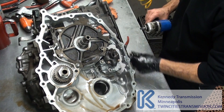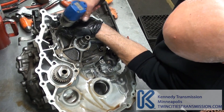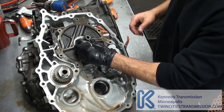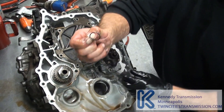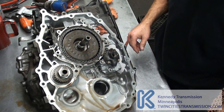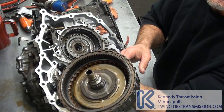Get down to your pump. Get all these 12s out. Pull your stator out — but first take this o-ring off or you'll lock up. The o-ring is right there, get that off, then pull the stator off. That looks like your forward drum with the forward clutch back inside there.